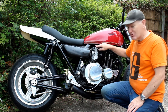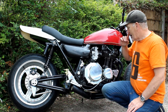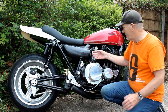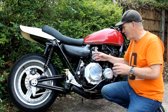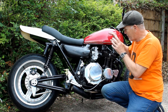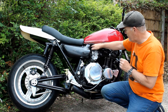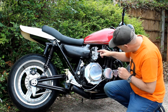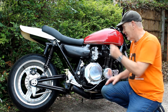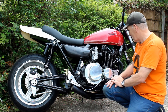Something I didn't mention yesterday is that I've fitted the Mikuni RS 2034 carbs - a bit fiddly but they went on okay. One issue is that without an airbox - just individual foam or cone filters - all the weight of the carbs is being held by the inlet rubbers, which isn't ideal. Now that the carbs are on the engine I can make a small bracket from the center of the carb tops up to a point on the frame to help support their weight - something that had to wait until the carbs were actually in place.